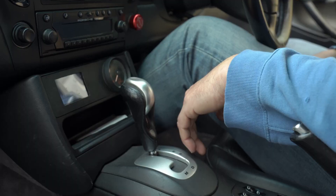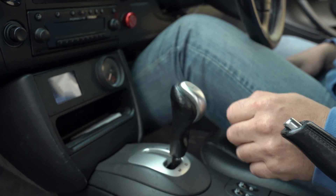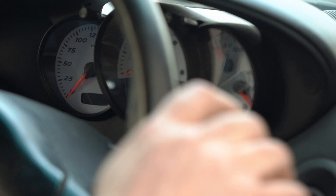This is the normal auto unit — the key is totally wired up. We literally select reverse to go reverse and select drive to go drive — it's literally two micro switches. And all the dials — we're working on the dials, we've got most of them working. It's just a matter of someone developing the software and doing the coding to get it all working through CAN. But yeah, it's all getting there. At one point this should all be working, so it's a pretty simple, easy build really.